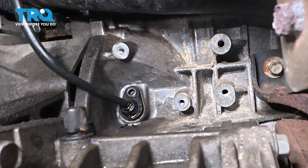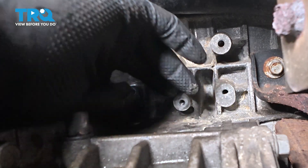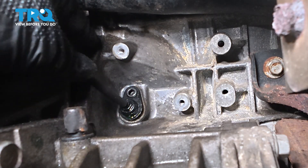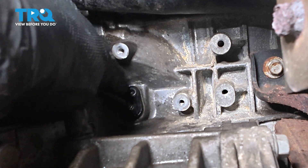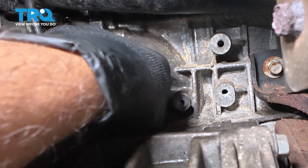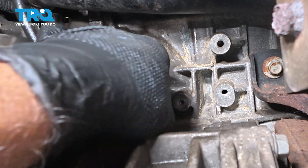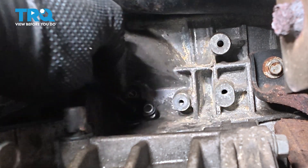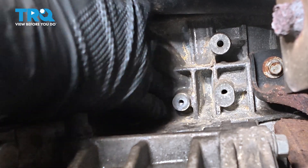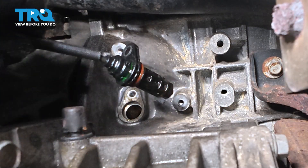The sensor is held into the block and there's an O-ring on it. I'm going to grab this and try and spin it a little bit. Right here where the bolt went in — if we can rotate that a little bit. See how I spun it off to the side? You can get your fingers behind it and pull it out. And there you have it.